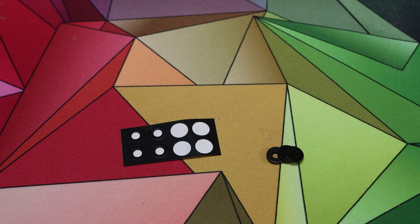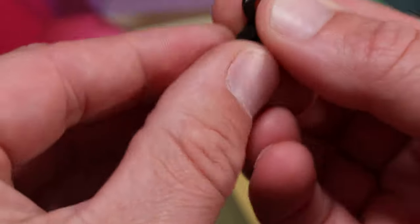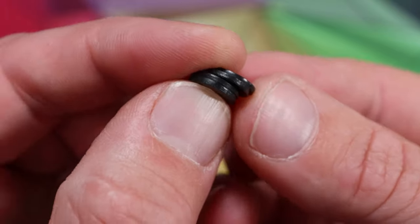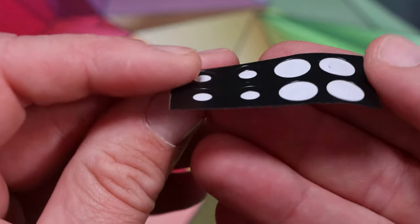Now the fix is very easy but it does require a little bit of preparation. You'll need a Torx T20 screwdriver or bit, and it does need to be exactly that size and specification. If you don't have a Torx T20 bit or screwdriver, do go out and buy one for this job. Don't try to get away with an Allen key or a crosshead screwdriver, because if you slip off the screw head and onto the surface of the motherboard you could damage it irreparably. The washers you need are small round washers with between 0.5 and 1 millimeter maximum thickness. I've actually had some really good results just with thin plastic motherboard protection washers that come with some AIOs or coolers.